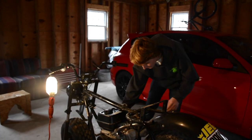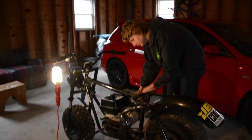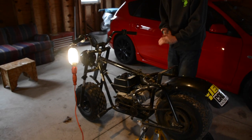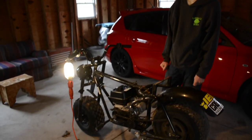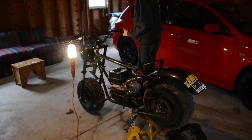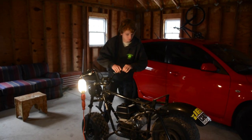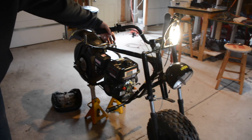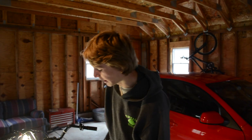We're going to show you a demonstration now. Normally when we start the bike up, the back tire wouldn't move because the clutch would be slipping, like it's made to do. But instead, when we fire it up, the tire will just start spinning because the clutch will grab right away and spin at the same RPM as the engine. You can see the clutch is not slipping — it's just grabbing and spinning at a really low RPM, basically idling while spinning the tire.